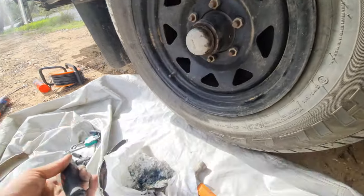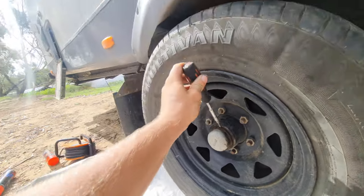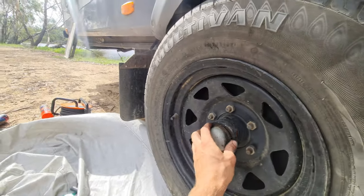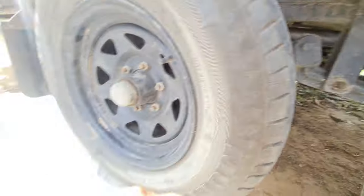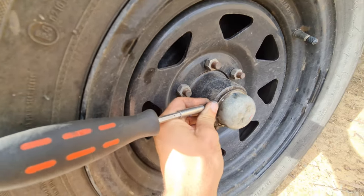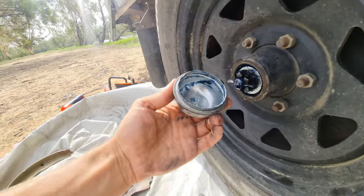First things first, you've got to crack this fella off. Best way to do it is get a flat blade and go around it a little bit. First jack off the tire and then put that in and give it a couple of hits. Usually you'll have to knock it a little bit all the way around. Try not to use a hammer straight onto this because you will buckle it. Just be persistent — it will come out. It gets pretty deep in there, so just keep going, work your way around, keep turning it. Eventually it will come out enough for you to wobble it out or just pop right off.